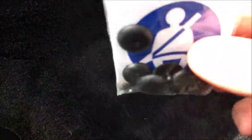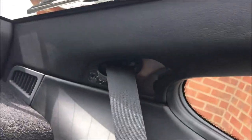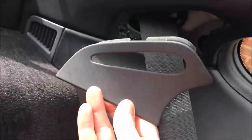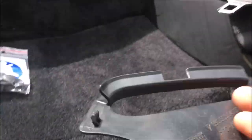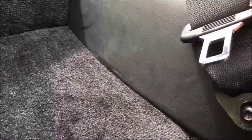On the seat belt itself, a little further up you'll see a small tab which stops the buckle from going all the way down to the bottom. Using your pry tool or flathead screwdriver, just break the tab — these cost pennies and I have a packet of Porsche ones in the garage, they come in packets of about 10. Once you've done that you can hide the seat belt so it's not flapping around. Up in the top corner there is a trim panel with two slots on top which slot into the back of the pillar, and two little clips on the bottom. Remove the trim tab, slide the buckle all the way down, and you can put it up and hide it behind the original aperture.